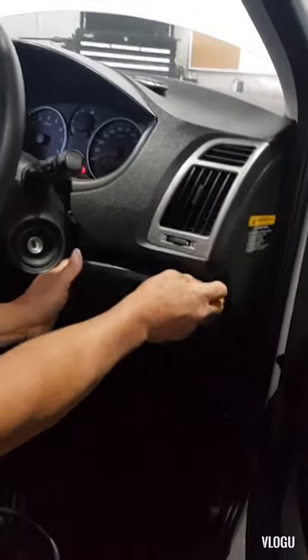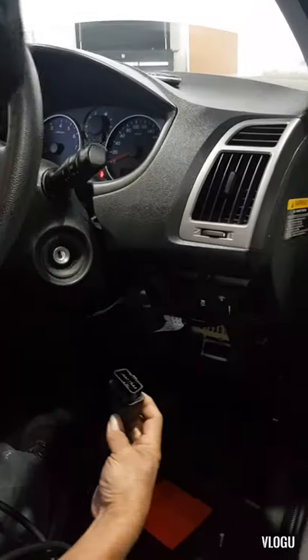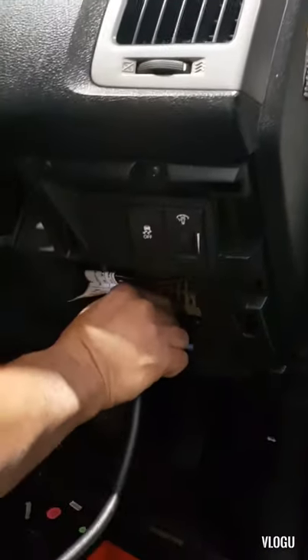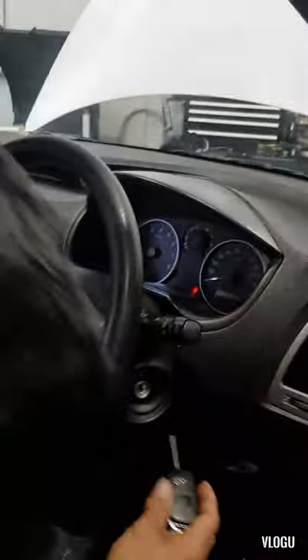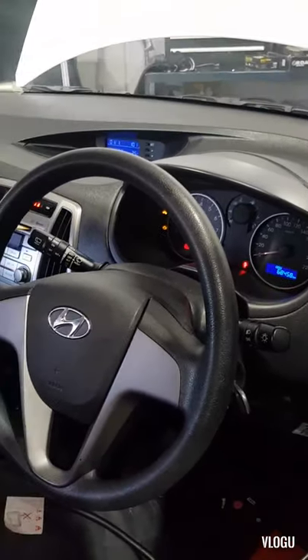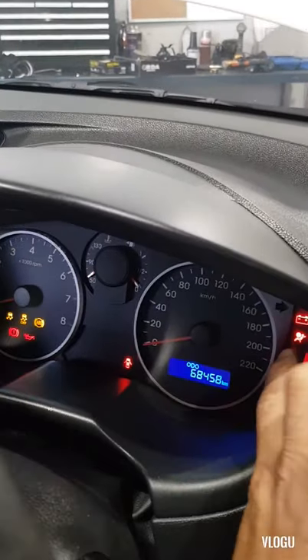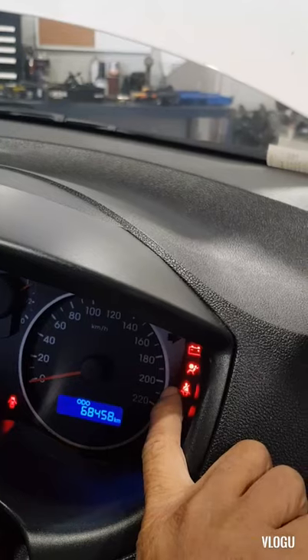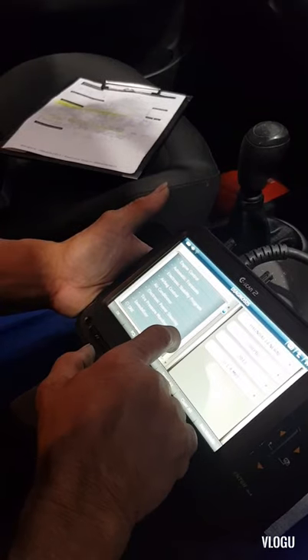The DLC cable for here, you have to pop this one out and it's over there. Once the airbag light is on, if there is no problem, it comes off in maybe five seconds. See, it's come off - no airbag fault. So there's no code.